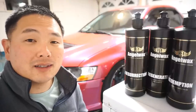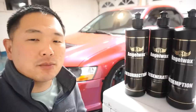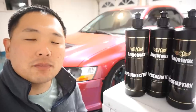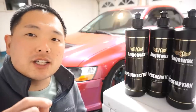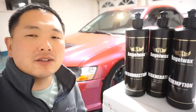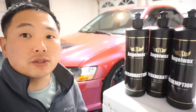Welcome back — to wrap up today's video, it was just to make a simple video on polishing basics: arm movement, working passes, priming your pad, and cleaning your pad. Always work as clean as possible. Besides cleaning with a pad conditioning brush every panel or couple of panels, switch out your pad. The Lake Country white CCS pad I was using was bogging down after correcting a couple of cars — it was done, so I threw it out. Pads are relatively cheap; buy new ones to get the most out of your correction process.